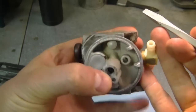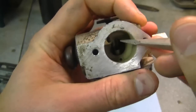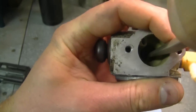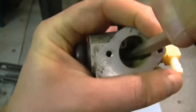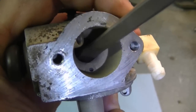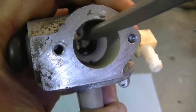To get the emulsion tube out of the carburetor, I grab a slotted screwdriver, reach down inside, and put it straight on top. Then I push down — you're going to see the emulsion tube go down a little bit. When I push down the emulsion tube it wants to come back up on its own, because of the o-rings on the tube causing it to spring back.